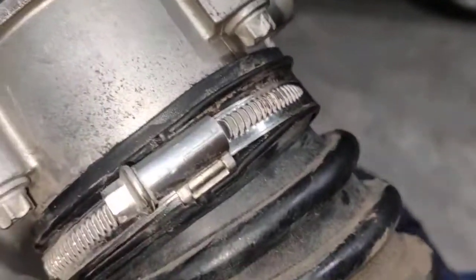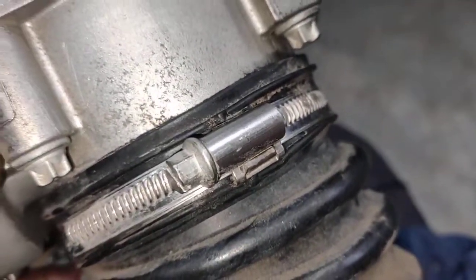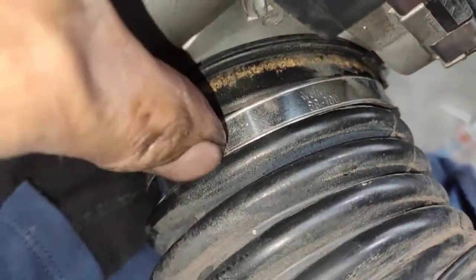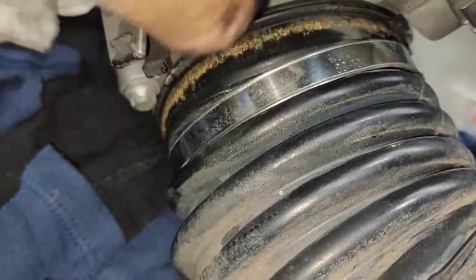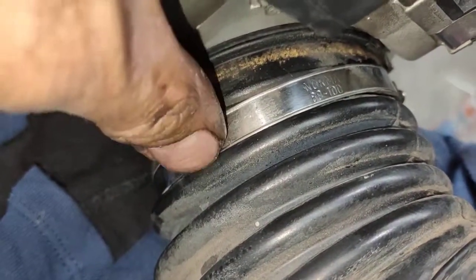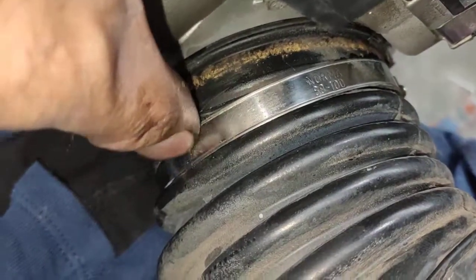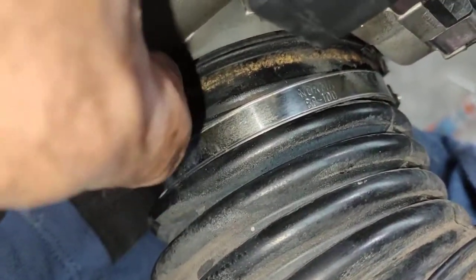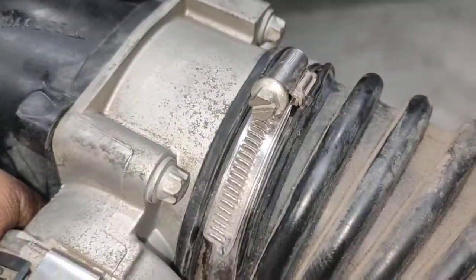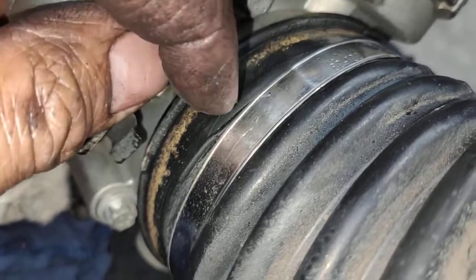Have a look at the actual hose clamp. There's a hose clamp there — let me spin it around. See the hose clamp? It's going the wrong way. The hose clamp is tight, and the hose clamp is on this side here. So somebody's been working on this car before — I can tell anyway. They didn't put it in properly because they didn't take it out properly. They were probably just mucking around. But now I'm going to take the hose clamp off and refit it back to this side here, where it should be. Not here.